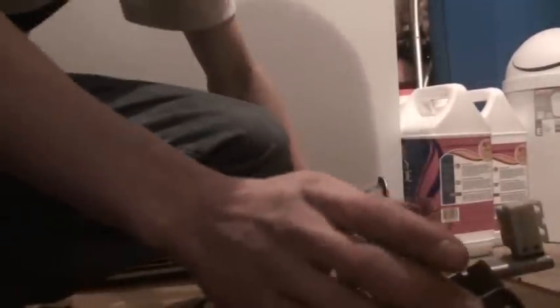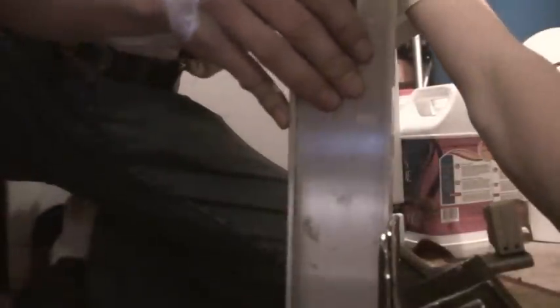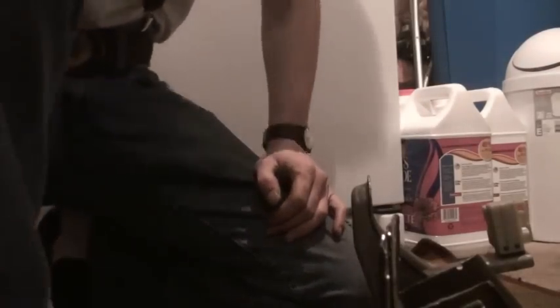It's bent now. Here's how I tell if it's bent good or not - this is my method. I don't know Purple ZJ's method or anything like that, but I made sure it was flat and I put a level on it. Took the reading at the top, then did the same for here and took the reading. It's exactly the same.